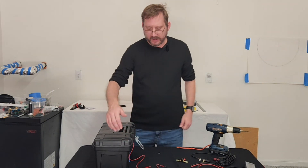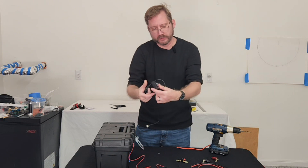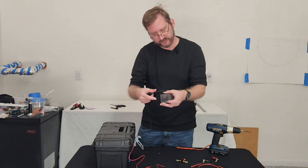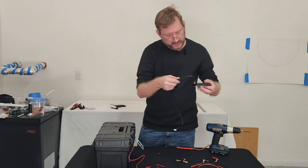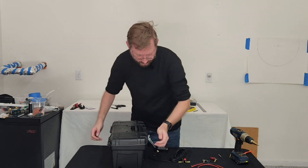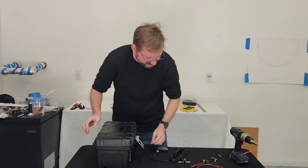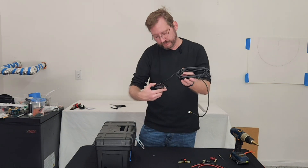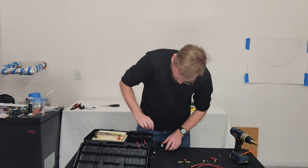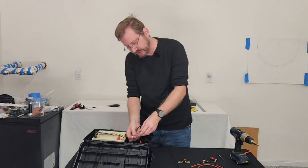The shunt is in, and now I'm going to cut a hole in the front for the meter. There's a wiring harness on the back side, so I've got to make some room for that to pass through. Put some more Velcro on the back of this. We've got a hole in the front — I'm just going to feed the harness cable through and put some Velcro on the back of the monitor. Then plug the other end of the harness back into the shunt.